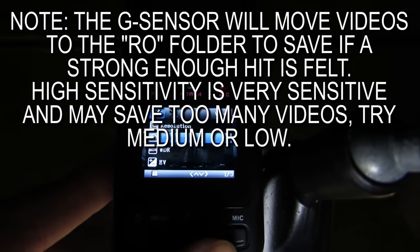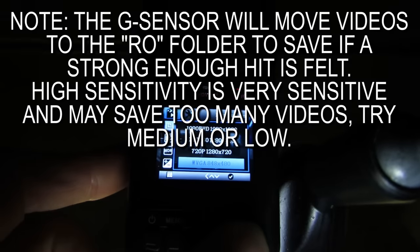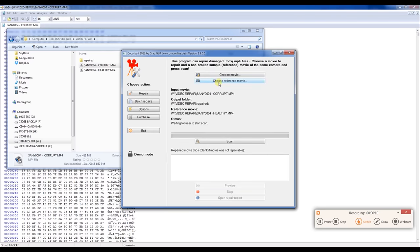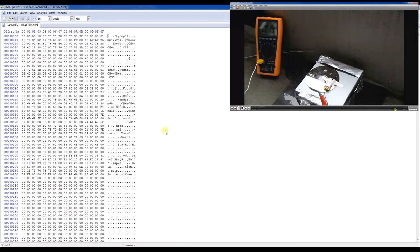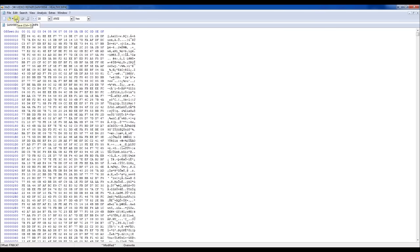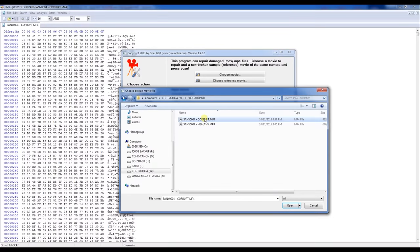The camera records about seven to eight hours on one 32GB card, which is pretty standard for 1080p video. You can get a little more time at 720p, but if you need to read plates I recommend staying at 1080p. As a quick tip, if any video files become corrupt in your cameras or DVRs, all you need is an original healthy video file and the corrupt one — put it through a program called Grau GBR Video Repair Tool, which repairs your corrupt video using your healthy video. The demo only allows you to repair the first half, but that's usually good enough. This video repair tool has worked on all the video files I've ever needed to repair — it's quick and reliable.